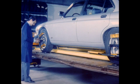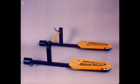The equipment necessary to check Jaguar alignment must be capable of measuring four-wheel alignment. Sliding wheel plates at all four wheels are necessary to enable accurate measurement of the fully independent suspension. Periodic recalibration of the equipment is necessary to ensure continued accurate results.